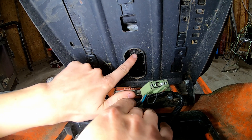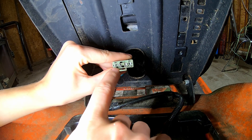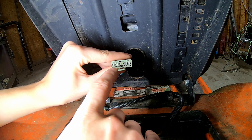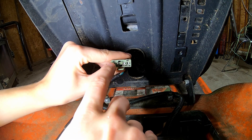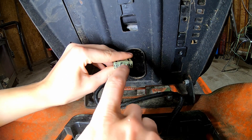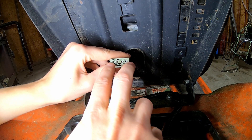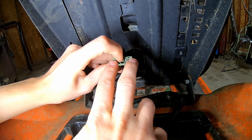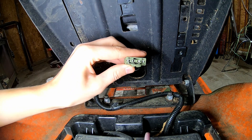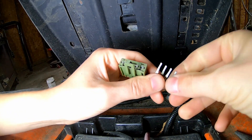There's a small metal bar with four tangs inside. When this connector is pulled out, that shorting bar goes up, contacts each one of these wires, and shorts them all together. What you have to do — and the easiest way — is to pull that out. I've seen other variations of this switch where it's not a four-prong shorting bar but only the middle two, and it's the same concept. It needs to be pulled out because when disconnected, it shorts the two to ground. So you can get in here with a pair of needle nose pliers and pull it out. And there's your shorting bar.